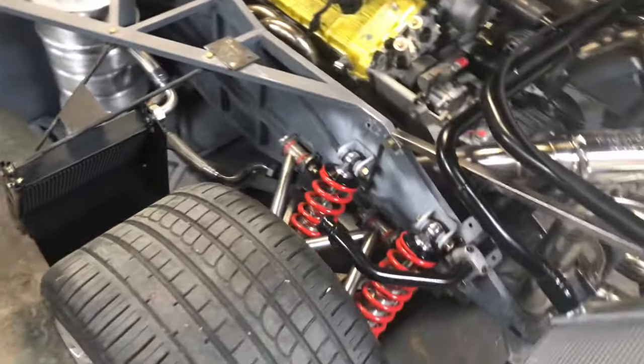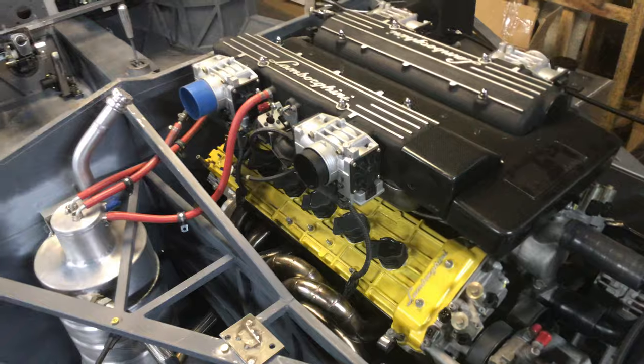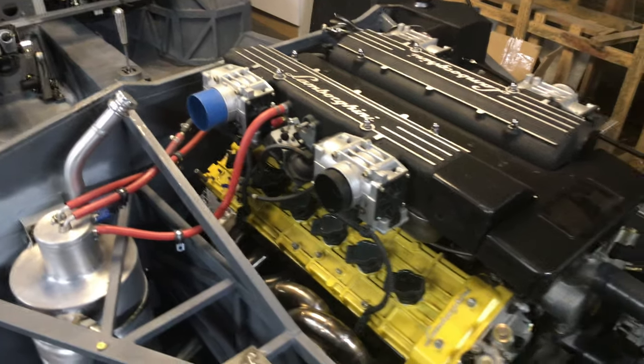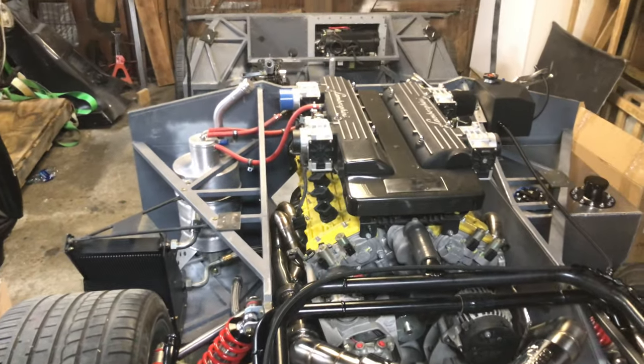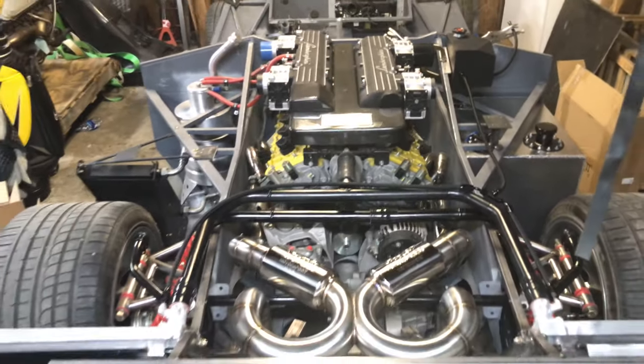Going forward, I've got a bunch of silicone couplings and clamp bands here for the coolant lines, and more couplings and bands for the intakes. Those silicone couplings will go on the throttle bodies. I'm going to make pie-cut stainless steel intake pipes with cone air filters on them — ordered those and they should be here next week. Thanks for watching.